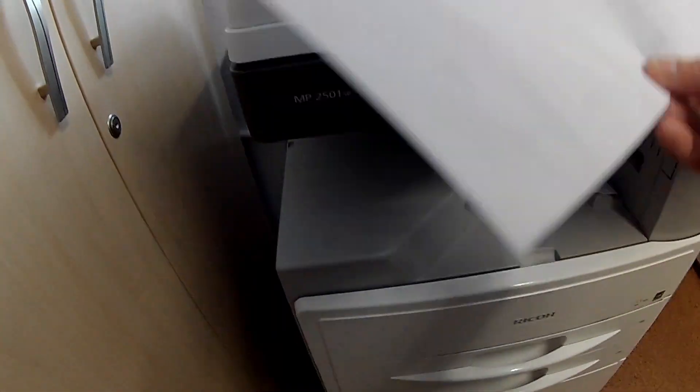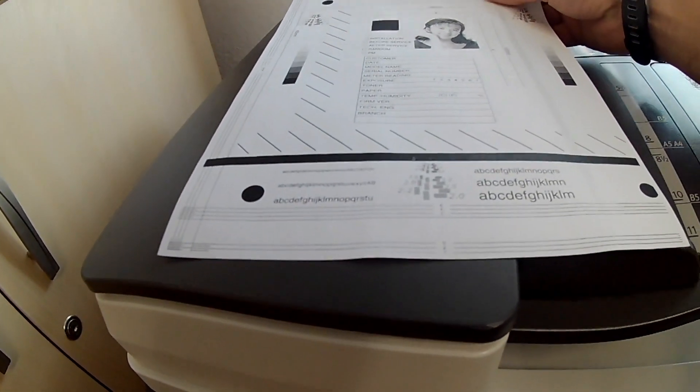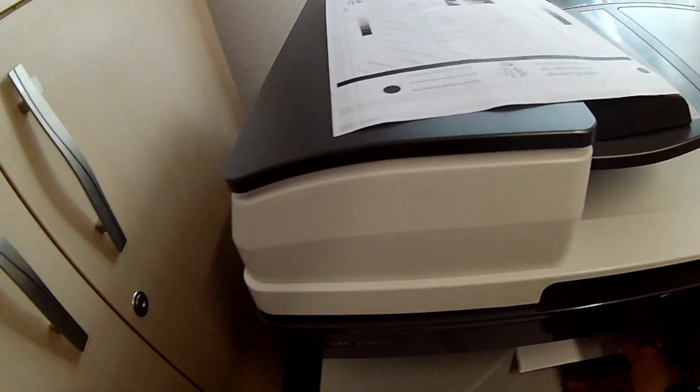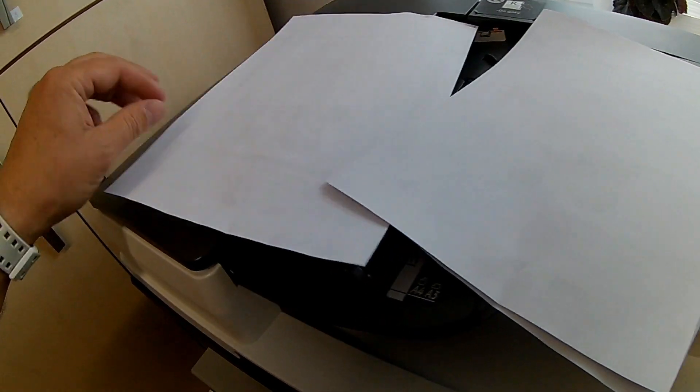The first copies are dirty on the reverse side. This is a serious problem. This proves that the copier has a worn-out developer. This is not a malfunction — this is a used consumable. So just replace the developer and other components designed for a lifetime of 60,000 copies.